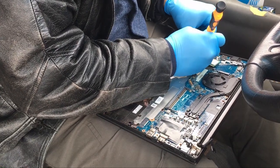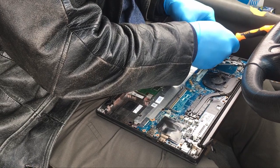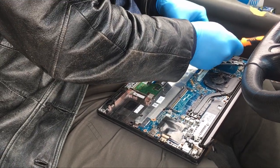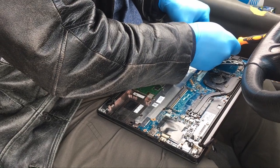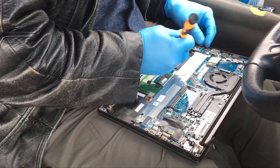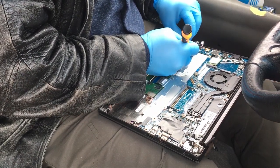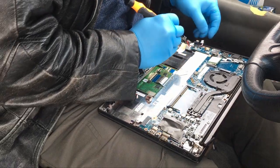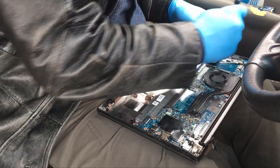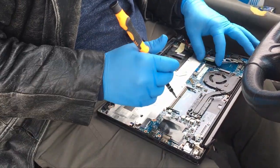Down here at the bottom corner on my left-hand side there are two plugs that I'll be releasing. One is for the power button, which includes the LED. The other one is for the front-end speakers. There's also a little watch battery plugged in down there, but we generally just leave it in — you get a new watch battery with the new system board when you put it in.